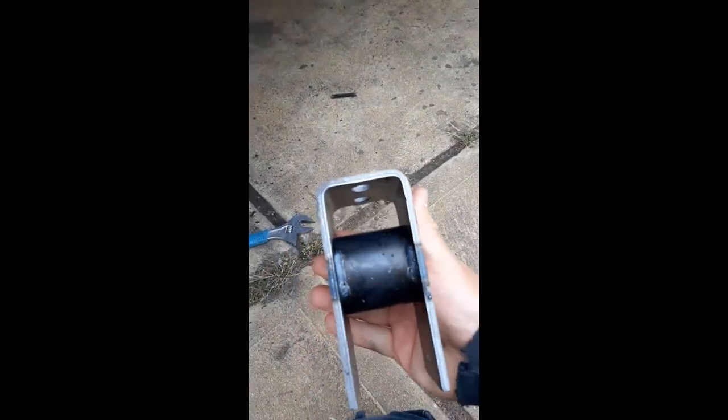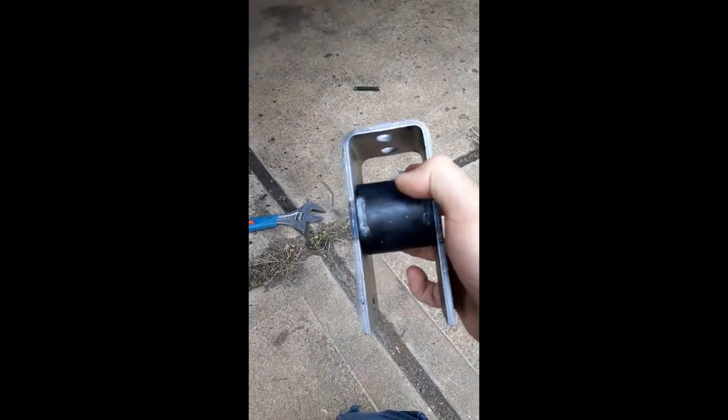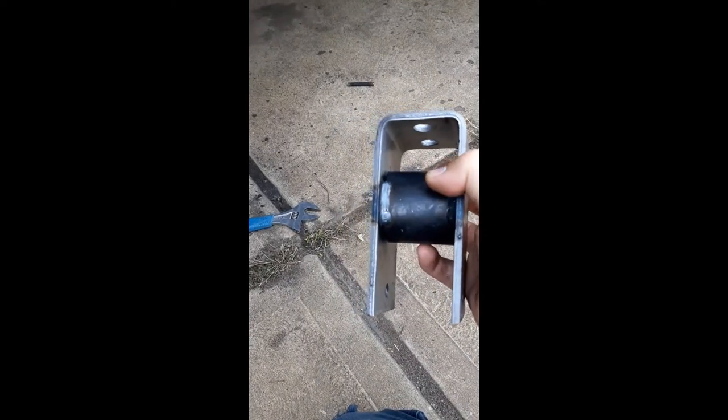You can see right here, there's supposed to be a pipe welded in to give it a better angle for the spring to ride on. It slips back and forth. I got a new one here. So the spring sits under here and rides on this. I guess it wore it out to the point there's basically nothing left, just the top part.